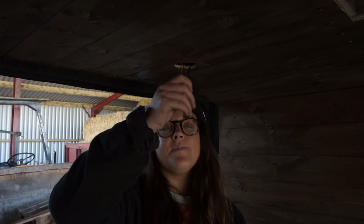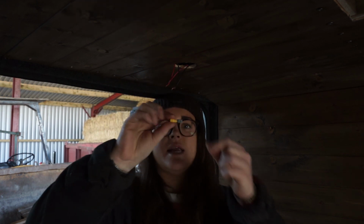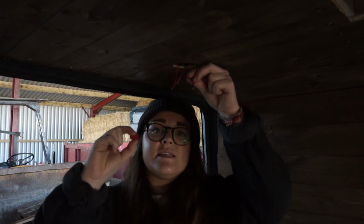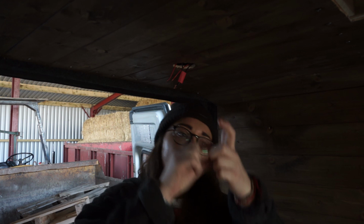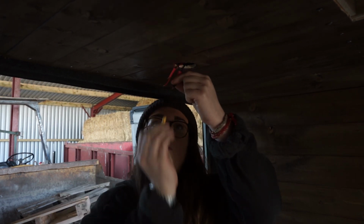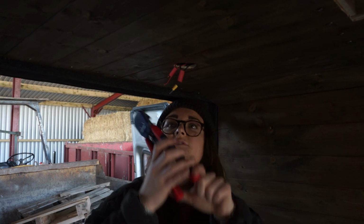Okay, there's a lot of loud noise in the background. Not sure if you're going to be able to hear me. I said that I was going to show you guys how I did the other lights with these little connectors. This one fell off, so I'm going to redo it. Fell off because it was just hanging out. So what I'm going to do, I've got a couple of pieces of heat shrink. So I've got my 2 negative wires and my 2 positives. So I'm just going to run some heat shrink there. Then I've got these 2 little blade terminals. I'm going to twist the 2 negative wires together and pop that onto that. I've not got a lot of wire, so I've made it very difficult for myself.